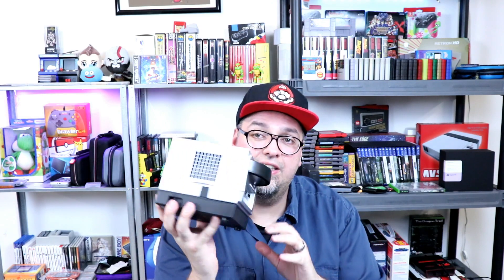What I like about the GCHD is that it's transferable — plug and play, you can use this on any compatible GameCube. The one thing to note is that your GameCube does need to have the digital AV out. Regardless of what you hear, these systems are not rare; the model number is DOL-001. If you look that up on eBay, you'll easily find them. I got this silver one for around $40 complete with power and a decent controller, and I found another for about $15. So they're out there, they're not rare. Nintendo removed that digital port in later revisions, so you do have to pay attention to that.